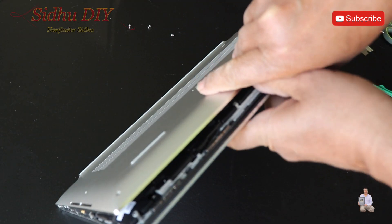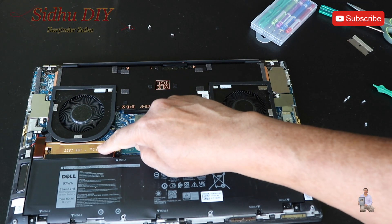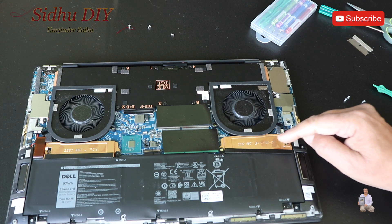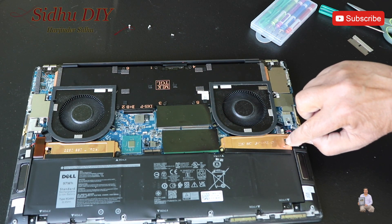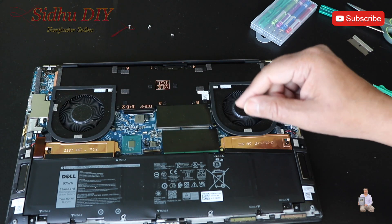So just be careful. Once it's opened up, you keep it in the same place. The location we have for our SSD is very easy to find. You can easily tell if there is an SSD inside. As you can see, there's the SSD on the motherboard right there, and this other slot is a dummy one. So we're going to open this slot and put the new one in — very easy and simple.